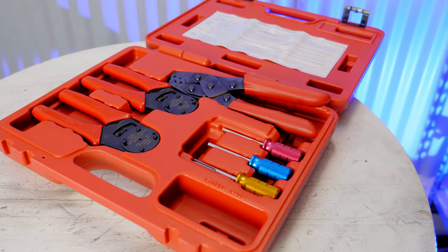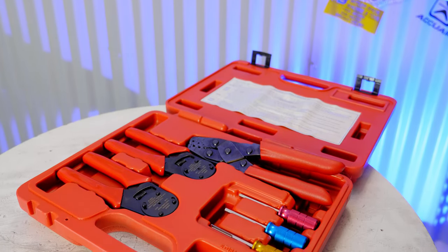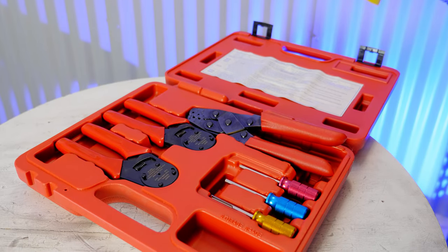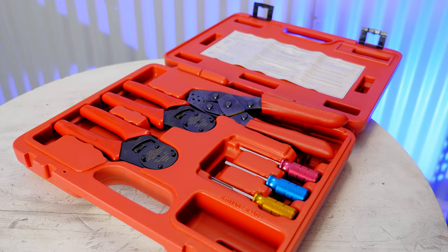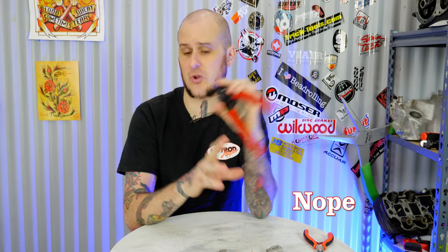In my case that means I have three different sets of the closed barrel type crimpers, and there are two bigger sizes I haven't bought yet because they're a couple hundred dollars even for the Tool Aid versions. That is the hurdle with Deutsch connectors — you do have to invest in proper tools. I have a set from Tool Aid that comes with two closed barrel type crimpers: the 20-22 gauge and the 14-16 gauge, plus those open barrel crimpers I really like. Honestly, that set cost me about the same price as the 12-gauge closed barrel crimpers alone. It's a really good set to get when starting out. All of these tools will be linked in the description down below.